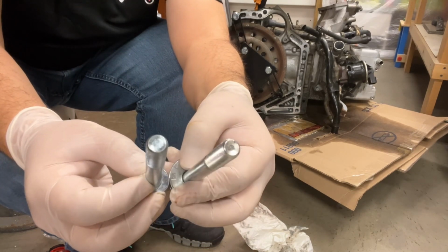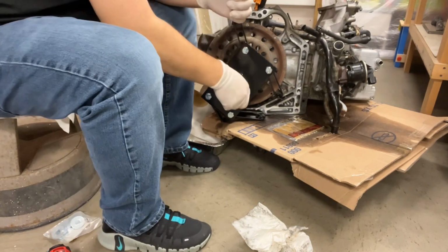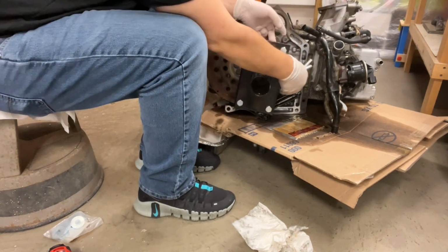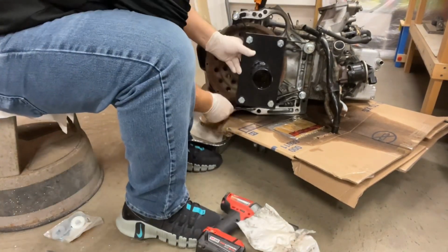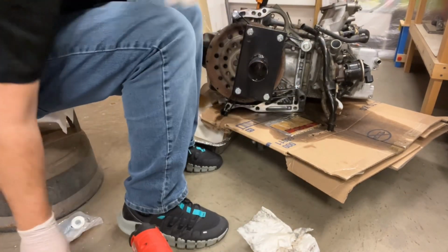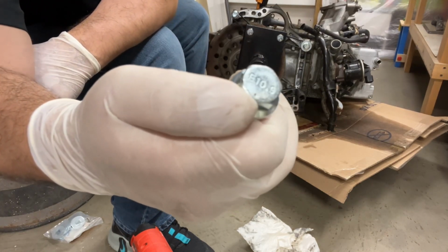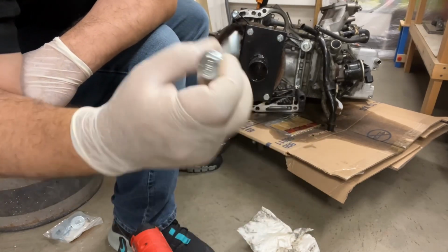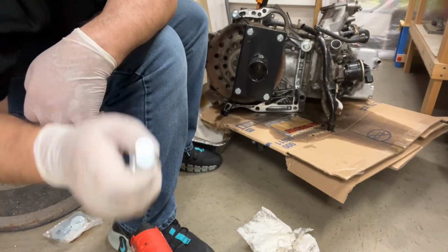We're gonna use 3 washers on 2 of those bolts. Well, there's actually 1 because the other one has to go in with the nut in the back. All right, let's see. One thing that I would like to point out is that these are great 10.9 bolts. With this small engine, you could also use an 8.8, I guess, but 10.9 is the best thing to use for engines. Okay, it's not just any bolt; it has to be graded for it. It has to be a strong bolt.